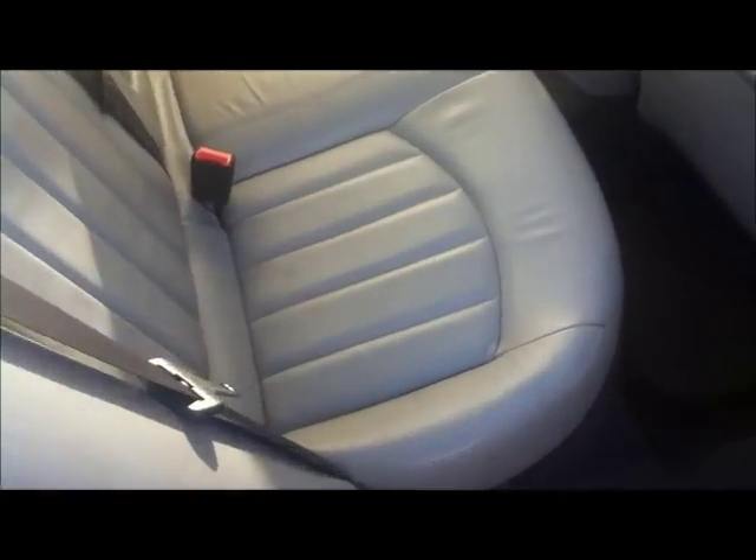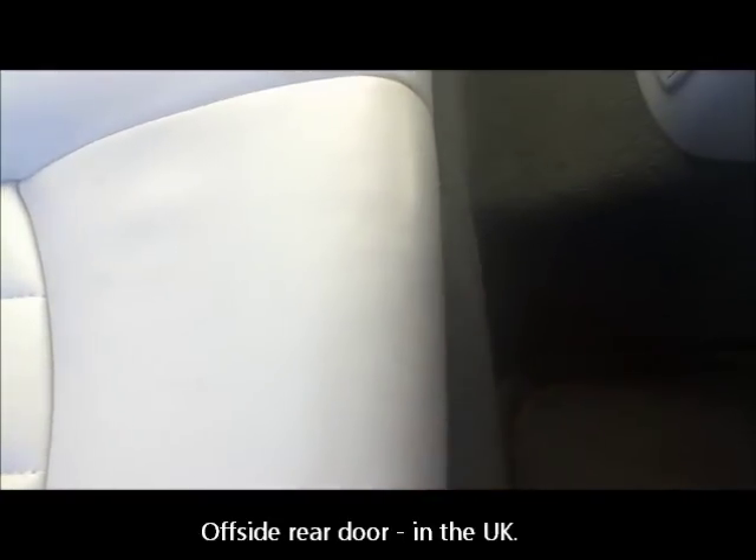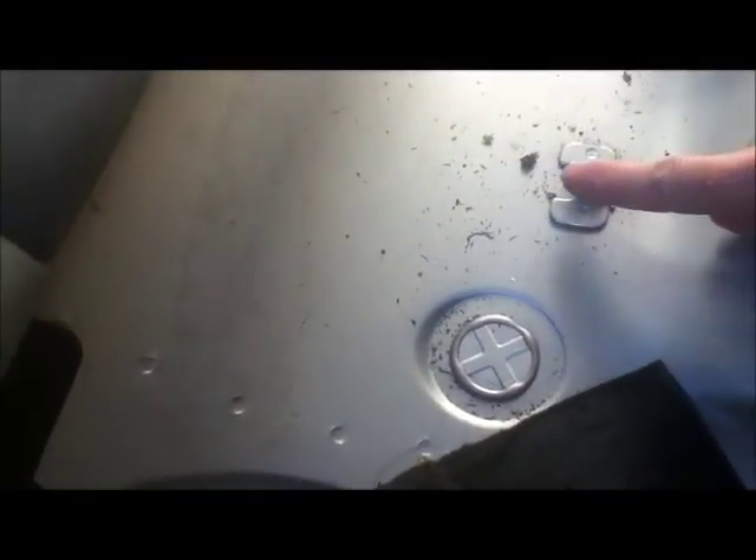To get to the floor pan it's underneath the squab seat. You need to pull the squab seat out — it's got clips here in the front, just under here, and you can just pull them out if you're strong enough. I've popped the seat out; that was harder than I remember. On the front of the seat there's a plastic socket that locates with a metal clip which you pull out with both hands. In the bottom of the pan is a hook that hooks into a metal bracket, and you have to use your knee to push the seat so it unhooks.